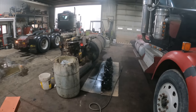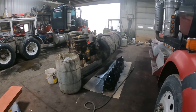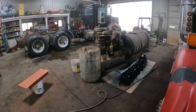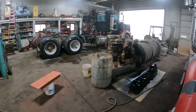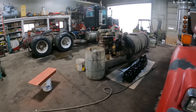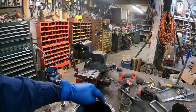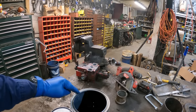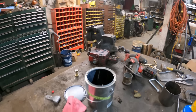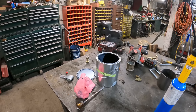We've got the POR sprayed onto there. Nate's just bringing the C5 back in. We'll get our paint gun cleaned up, let that tack up for an hour or so, and then we can throw on the top coat. I've got this lid all cleaned out — what I'll do is take a little bit of grease and put that in the top here so hopefully it doesn't glue itself shut. Let's go ahead and clean up and get ready for the top coat.